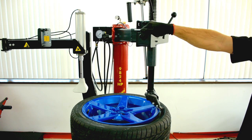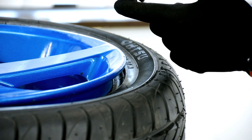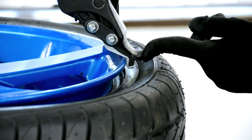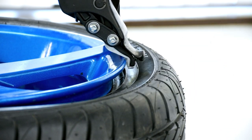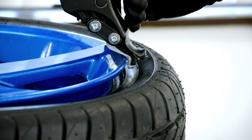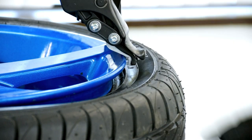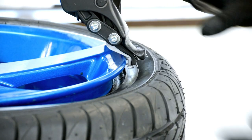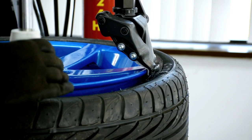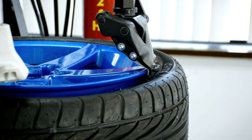As you can see, the arm is not opening right now — this is what you should look for when positioning the head against the wheel. We will lower the arm; this insert right here needs to be right around the edge of the wheel. Once we lock this, the head will actually take one millimeter out and one millimeter up in order to protect the edge of the wheel, but it needs to be pretty close in order to work properly. On some lower profile tires, we will need the help of the BPT to make sure the finger goes in and reaches the bead of the tire.